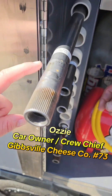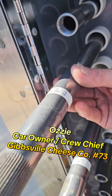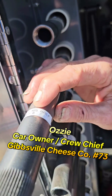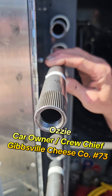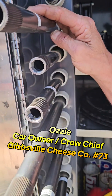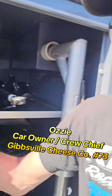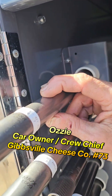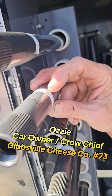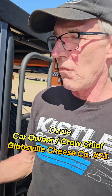Will a thousand bar always be the same rate? No. Here's a 10-25 at 511, and out here is a thousand bar at 425, while this other thousand bar is 463. These are custom rates measured at the shop. A 975 bar, for example, reads 421, and a thousand bar reads 425 — there's really not much difference even though the bar numbers are different.